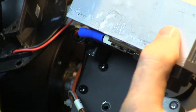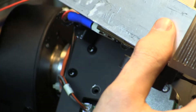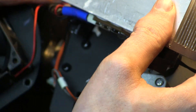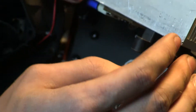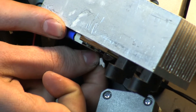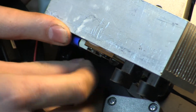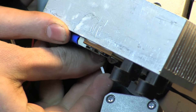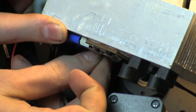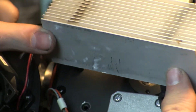Both are on. Now, I'm not going to be able to show you this because the fixture is tilted the wrong way, but you also have to remember to get the diode sensor cable back in. Remember, the side with the exposed wire portion and the little nipple — that's toward the top. Line them up and give them a good seating into the housing. Now you've got all your cables back in and all connections secured.